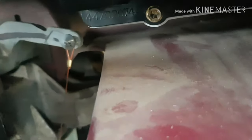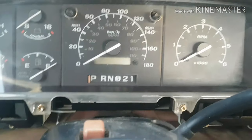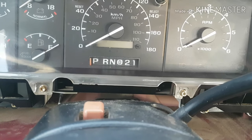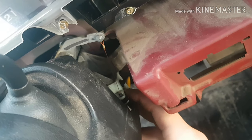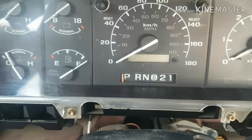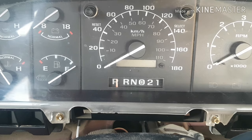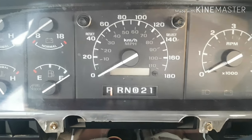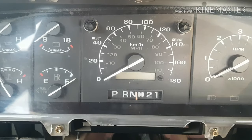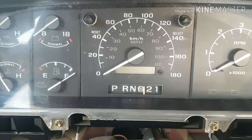The one thing that was different is this little guy down here — that's the cable that connects to this little orange thing. The different thing is you're going to have to readjust it. Put it in park, make sure it's all the way in park, and then spin the knob. This little knob right here — you're going to spin it towards you, which will pull the thing back. So you'll have to put it probably there on P, and then: Reverse, Neutral, Drive, Two, One.